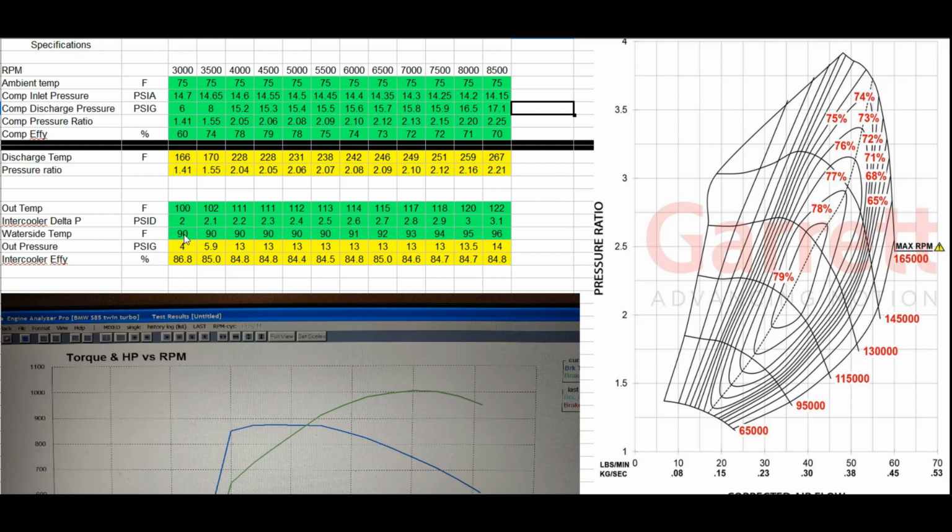Like a Super Coupe, for instance, has an air-to-air intercooler on it with an Eaton supercharger, and that has like 14 pounds of boost, and the piping is like 5 pounds of that. That's putting that Eaton supercharger in a really terrible position. That extra 5 pounds of pressure loss going through all those intercooler piping and connections and back to the intake manifold is quite a disaster, actually, even though those cars do run okay. So that's why liquid-air intercoolers are better, in my opinion, which is why the Allen one had that.